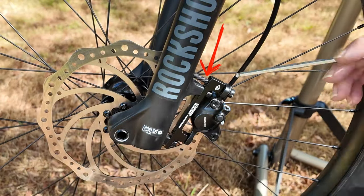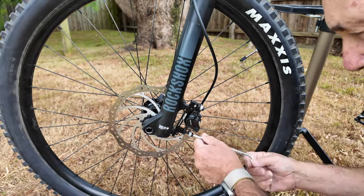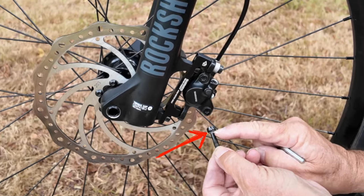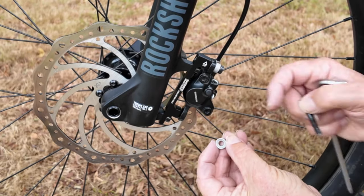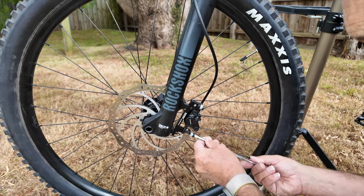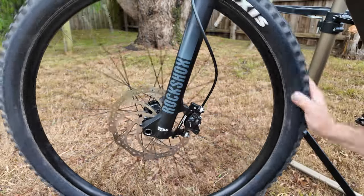I've cut the bolts down and put two cone-shaped washers on. These washers are supplied by Shimano. The bolts have a nice tapered undercarriage, and the washer has a concave indentation so they seat together. Now we've got the perfect situation — a spacer to take up the thread so we can bolt it directly. We are back in business.